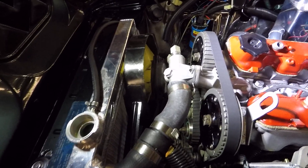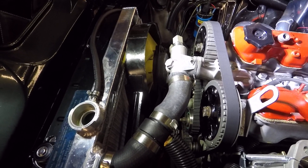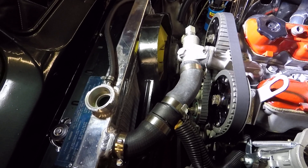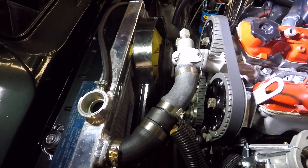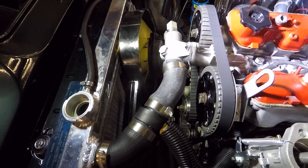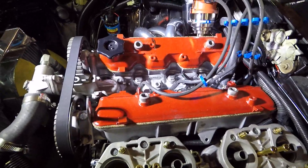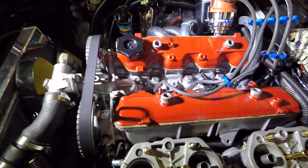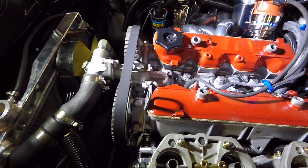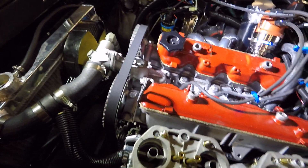One of the advantages of the electric water pump is without a thermostat, the engine temperature is controlled by the speed of the water pump and also by the cooling fan. On startup, you get slow circulation until the engine starts to reach operating temperature. Then the water pump picks up speed and circulates the water to keep the temperature at the setting you've chosen. With no thermostat and gradual warm-up, you don't get hot spots in the engine. On a car with a thermostat, you'll see temperatures up in the 220 range at the water outlet because the water's not circulating through the radiator yet as the engine warms up. It also runs for up to three minutes after shutdown to eliminate any hot spots in the engine, and can also run the cooling fan if need be during that time.